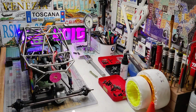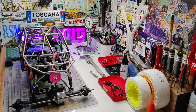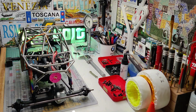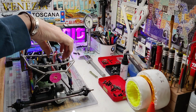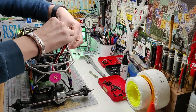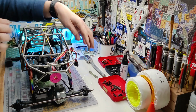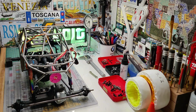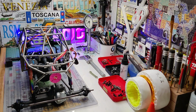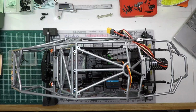Here we are again. We got the motor in with one bolt just to see how everything matches, and it doesn't. The front upper links are going to be a pain in the beep. They are not really cooperative. Mainly not the engine, but the gearbox is too low to attach them to the new mounts I made. So we're gonna be creative.